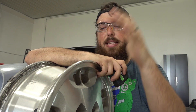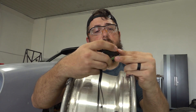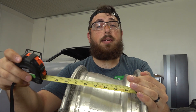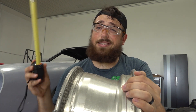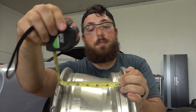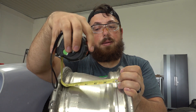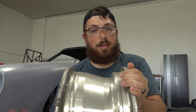One thing I wanted to point out before we continue is a note about wheel widths. Most folks would quickly measure from the outside to the outside and assume that gives them the wheel width — for this particular wheel, that comes out to seven and a half inches. However, this is actually a six and a half inch wide wheel. Much like a two by four is actually a one and a half by three and a half, the wheel width is measured from the inside of one lip to the inside of the other, not outside to outside. There's usually about an inch discrepancy between how wide a wheel actually measures versus how wide it's listed when you buy it.